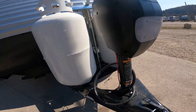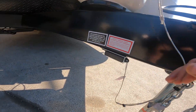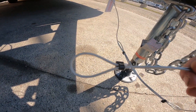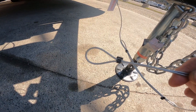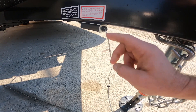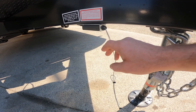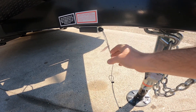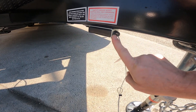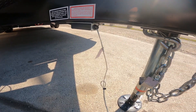Also on the front, before we move on, we'll make note of your safety breakaway switch. The loop end is attached to your tow vehicle, and in the event that the tow vehicle becomes separated from your RV, this pin will be pulled, engaging your trailer brakes. So if you ever notice that you've just hooked up and it feels like the brakes are stuck on or something isn't feeling right, come back to this and make sure the pin is fully inserted into the housing. If it's not, push it in and see if that fixes your problem.